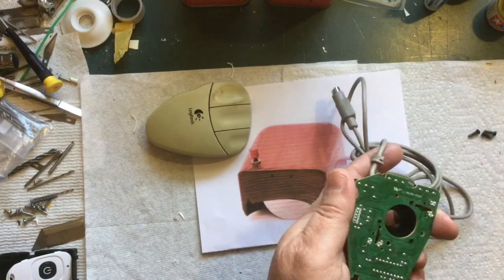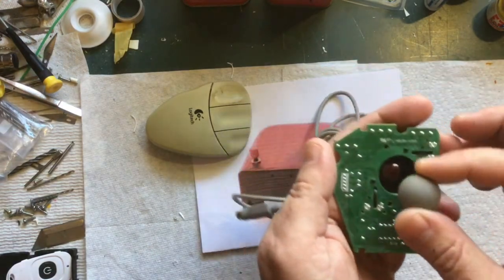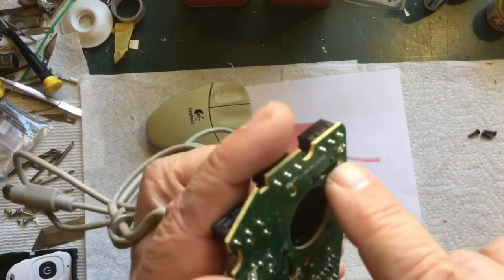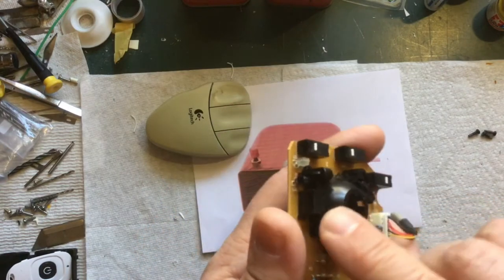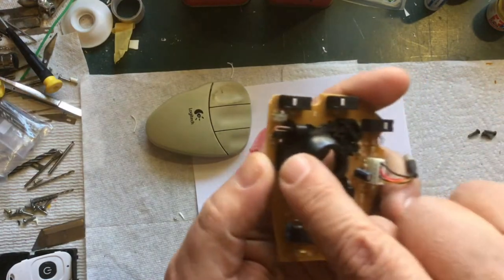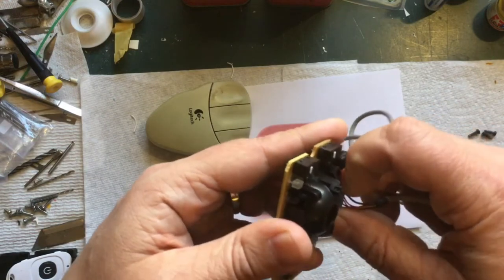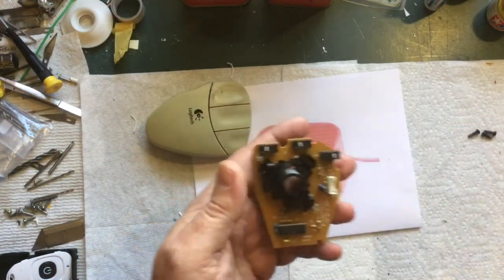For those who don't know how a ball mouse works: there's a ball, and as you roll it around the desk it moves two wheels. There's one wheel here and another wheel there — the ball turns those wheels. Those are little encoders: one encoder here and another one here. That tells the computer which direction you're moving. I'll unplug the cable for now so we're just looking at the board.